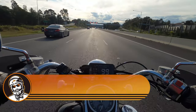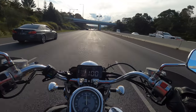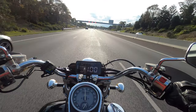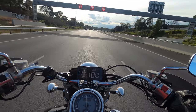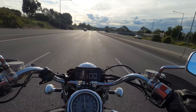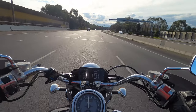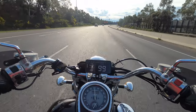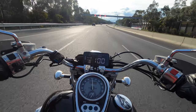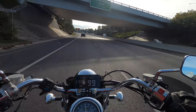If you're thinking of doing the HealTech Speedo Healer for your bike — I did this on a Vulcan VN 1500 FI, which is an older model bike — I recommend it. It is literally plug and play. Once you can get access to your speed sensor, you unplug it, the cable goes in between that and the box, find a spot to mount it, it comes with all the mounting hardware you need. This makes things so much easier. Big Rob out!